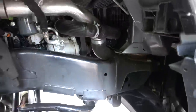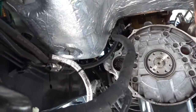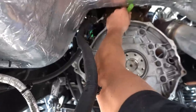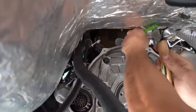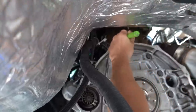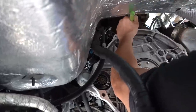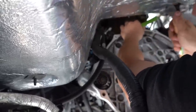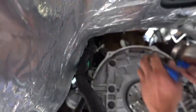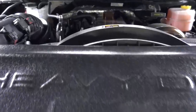We can see much easier access to that rear freeze plug right there, so we've got to pop that baby out. We're going to drain some of the coolant out — obviously we don't want to take a bath back here. The easiest way I've found to drain coolant out of these things is to pop off that lower hose just a little bit and let it drain. Then use a punch — stick it on the inside edge, not on the flat part — give it a whack. Then use needle nose pliers and pull it out the rest of the way. No coolant — that's a great sign.